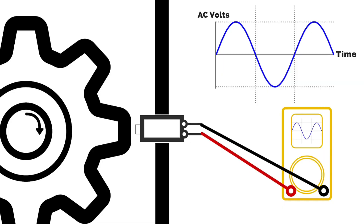When fitted to the vehicle, the sensor sits very close to the reluctor, which in this example is fitted to the crankshaft. As the crankshaft rotates, the edges of the teeth — and therefore the flux — move towards and away from the sensor, crossing the copper coil and generating a sinusoidal AC voltage, which in this diagram is displayed on an oscilloscope.